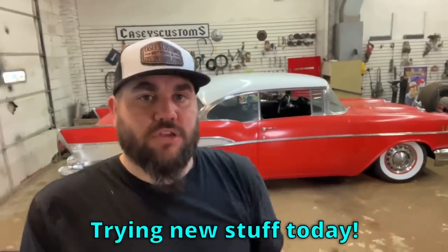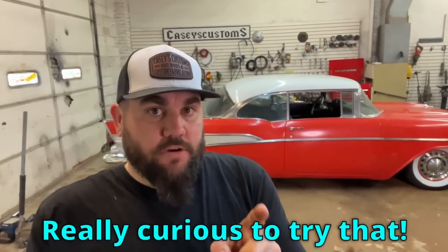I got hundreds and hundreds of people sending me messages, comments, emails on stuff to try. So I got some new parts. The main thing a lot of people said was ground, check your fuel pump. I had like 5 guys tell me, check your fuel filter in your tank. Even though it was a brand new tank, guys said they've clogged up a fuel filter within the first mile of driving it, just from like residue on the inside of the tank. So I'm really curious to try that.